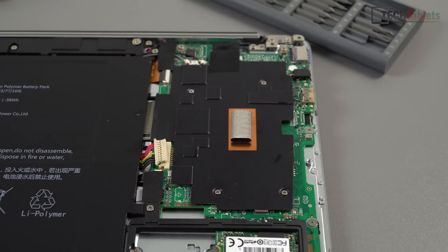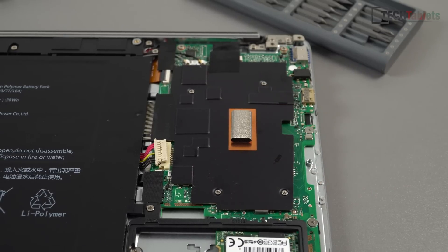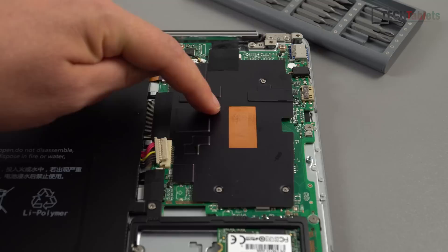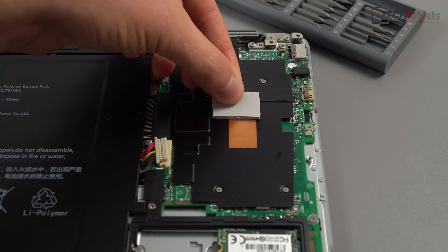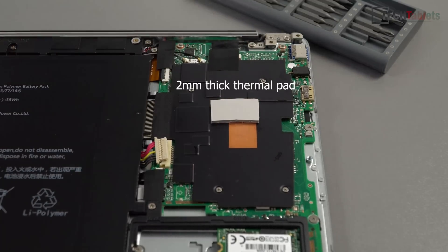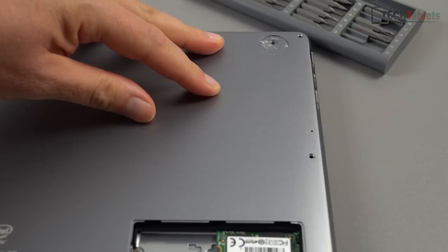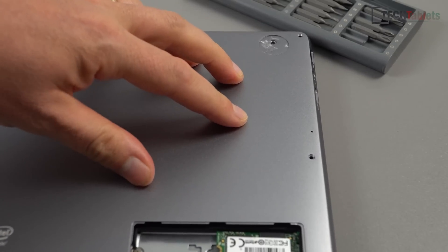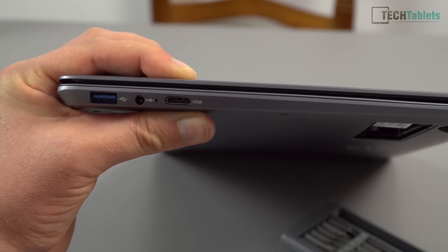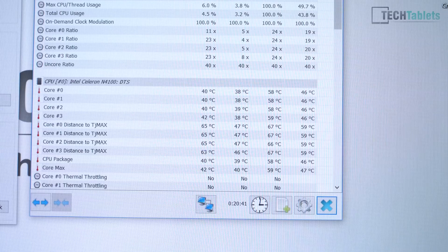That's now applying a lot of pressure on top of the chipset, which is what we want. The last step before plugging in the battery is to remove the existing pad and put a two millimeter thermal pad on top. Remember the chipset is offset, so place it accordingly — about there. I can feel it pressing down; two millimeters might be slightly thick, but once the screws are on it clips down fine and will apply a very decent amount of pressure. You could also go with one millimeter.